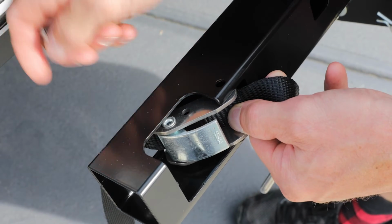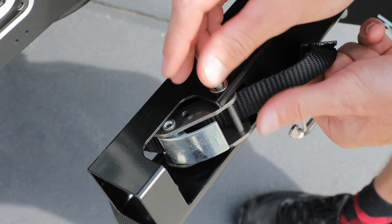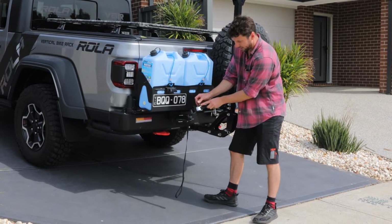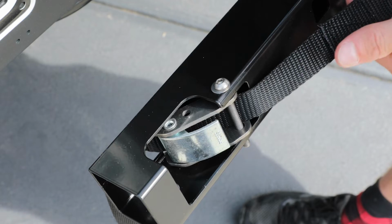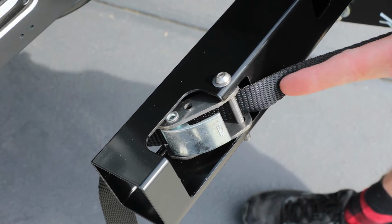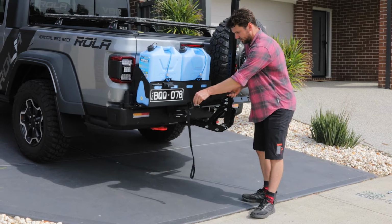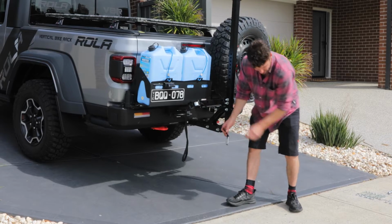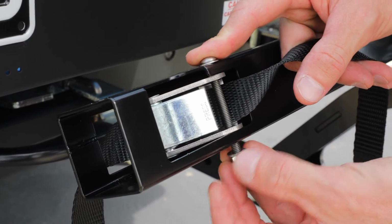They are for an M6 bolt, which slides in from the top. It should go through the hole in the cam buckle and the horizontal bar. The webbing should be behind this bolt, and then it should all fit in nice and secure so the webbing can be pulled through from behind the bolt. Then just attach the washer and M6 nut underneath.